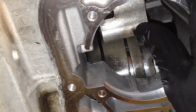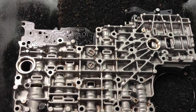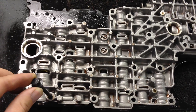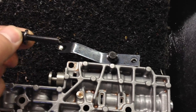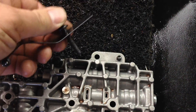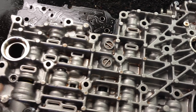As far as the valve body going back in, there are a few bolts that are different and I want to show them now for reference. This one right here is a 10mm head bolt with a big head — that goes there. Over here there's a small bolt that's all threads — that goes there. And then this one I told you to keep with the detent spring — that goes right there. All the rest are the same size.